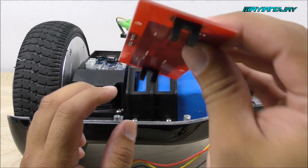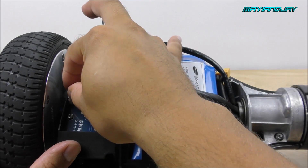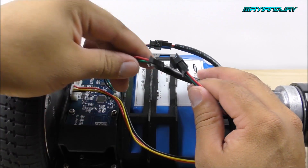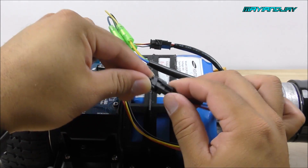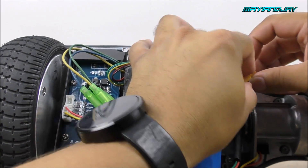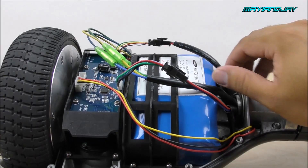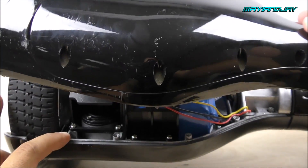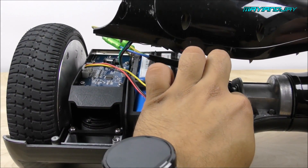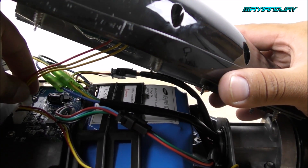Make sure the stick from the button of the scooter is in between the two little teeth and not on the sides, otherwise it's not going to work. Now connect the wires — the first one to connect is the last one you took out. All of them are very self-explanatory. After connecting the first connector, plug in the main one as well. Everything looks good. The next step is to connect the battery — don't forget it, I forgot on my first attempt and had to take it all back out. Now mount the bottom side of the scooter, and make sure not to forget to hook up the LED light back on the board.